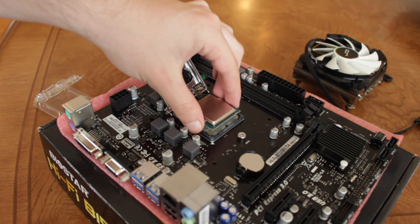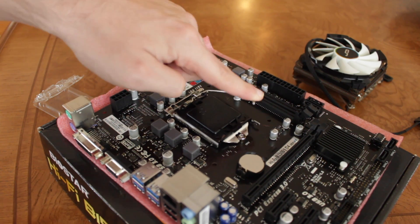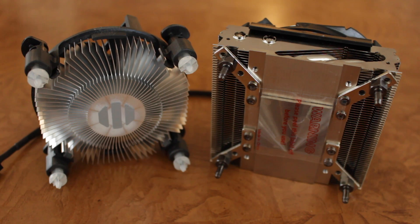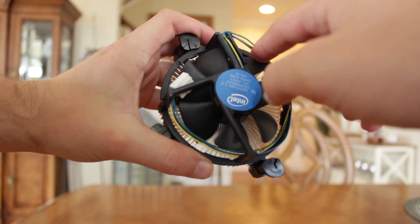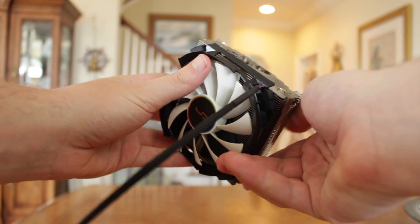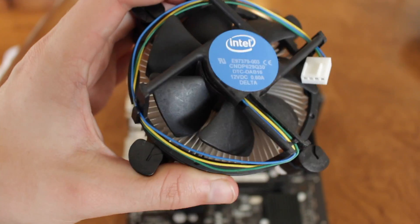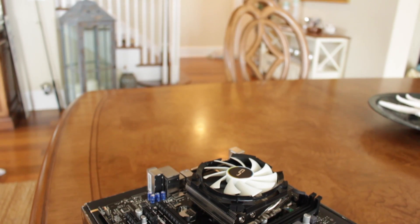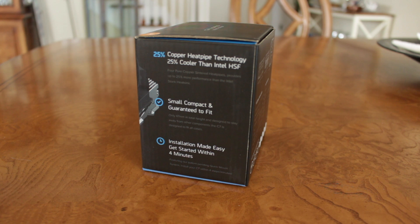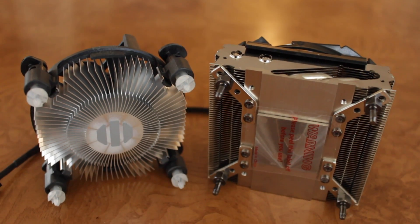In terms of testing, I used a Pentium G4400 with both the C7 and the stock Intel cooler, testing thermals and noise at idle and under full load. At idle, both coolers were basically indistinguishable from other system fans. The stock cooler idled around 36-37 degrees Celsius, while the C7 held steady at 31 degrees Celsius. It's once we put these coolers under heavy load that the C7 really stretches its legs. Under load, the stock cooler hit 62 degrees Celsius, while the C7 kept the G4400 at a cool 47 degrees — close to the 25% decrease in temps that Cryorig advertises on the box. In terms of noise under load, the C7 was considerably quieter with a decrease of around 20 decibels, which is the difference between annoying and tolerable.